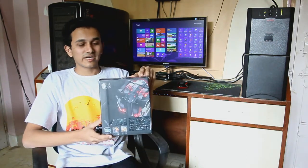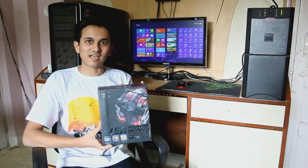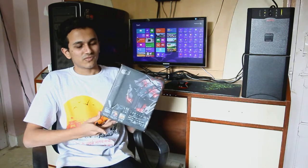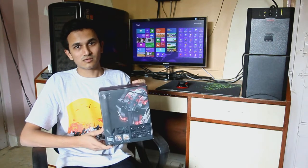The V8 GTS is designed basically for the overclockers and the gamers. This cooler looks pretty well and really shines if you have a side panel to show off your rig. It has red LEDs in it. This cooler has two 120mm fans sandwiched between three towers. It has eight heat pipes for maximum heat dissipation and they are using the horizontal vapor chamber technology in this cooler, which I'll be explaining in the conclusion part.